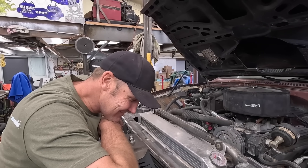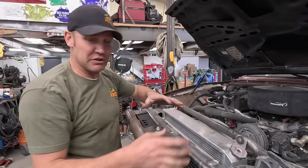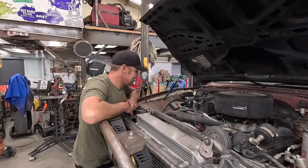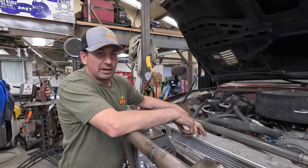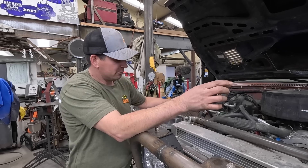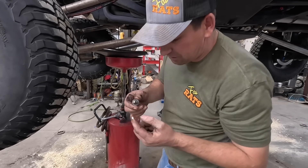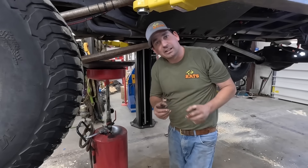There's hardly anything we have to take off to get to that. This is where you're like, 'All right boys, well I have to head to Kanab now' — like Michelle said. So you guys just have that right here when I get back, that'll be great. We need all these parts back. Holy cow — first off we're gonna lift it up and drain the coolant, radiator, engine oil, power steering. That one's probably gonna make a mess. Once those are all drained we'll set it back down. It was pretty black at first but now that it's running it looks pretty good.